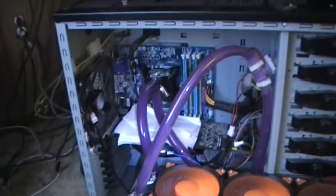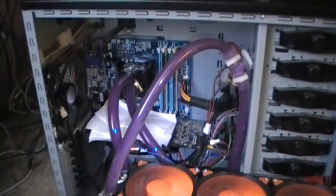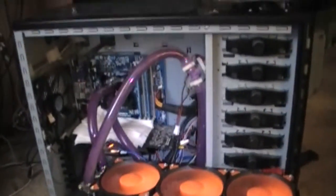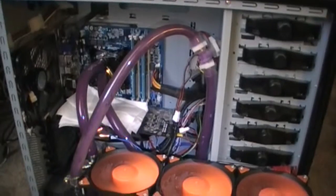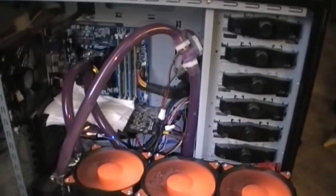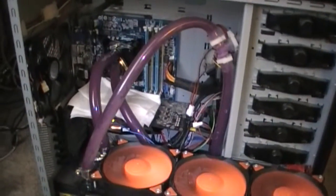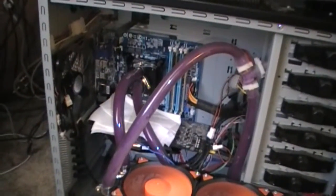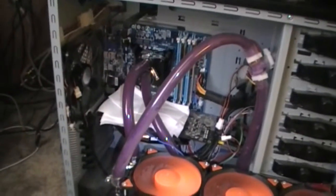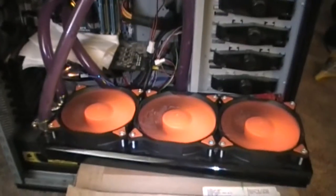Welcome back — this is the last part. Coolant is back in there; it may look a little brighter. I topped off the system and the coolant is a little fizzy right now. The cap is topped off and air is escaping. The whiteness you might see is actually air bubbles — small tiny bits of air, which is okay. The radiator is down here at the bottom to make sure all the air is being forced out.